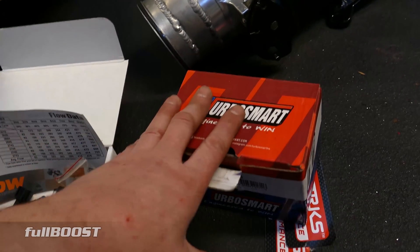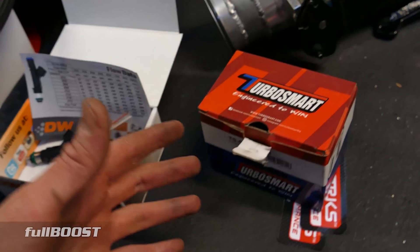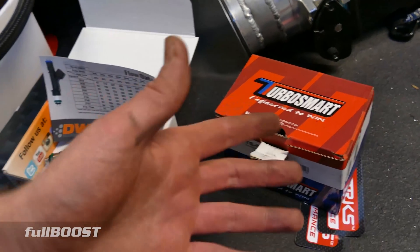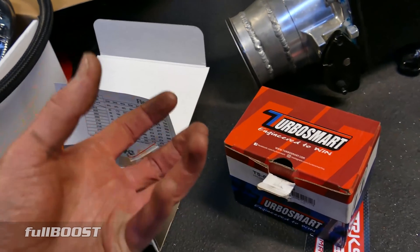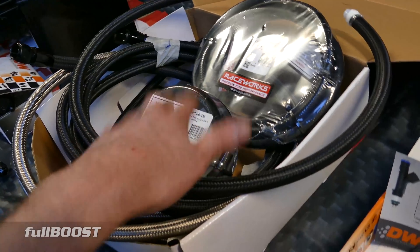This system will run at a base pressure of 40 psi, and if you're going to put a turbocharger on it, it will then run at 40 psi plus however much boost you run. So if you run 20 pounds of boost, that system's going to be holding 60 psi, and those old carbureted rubber fuel lines just won't do it.